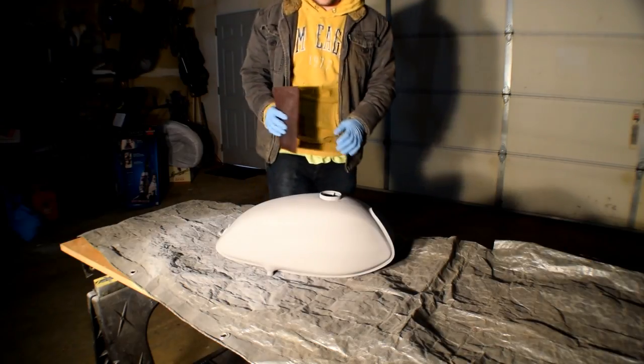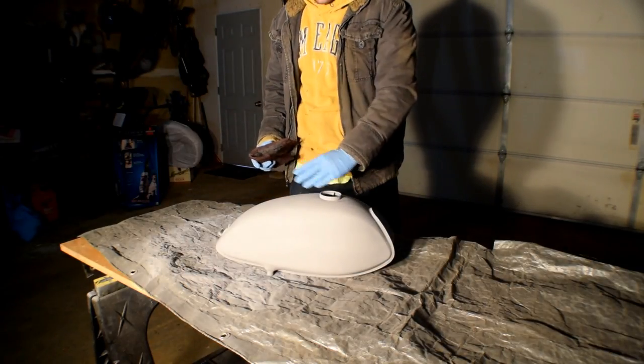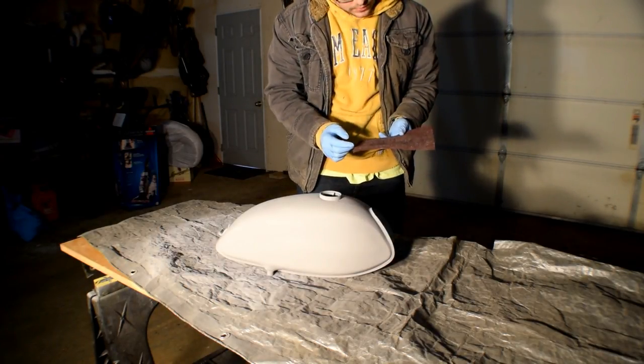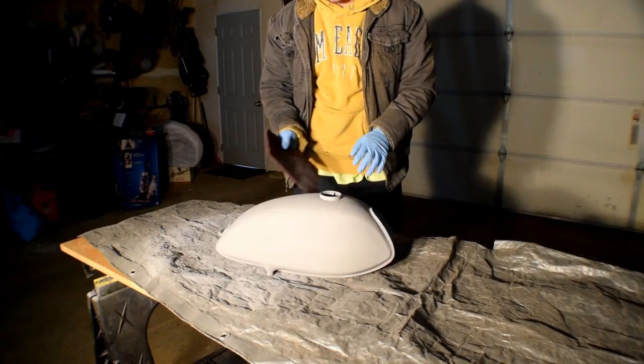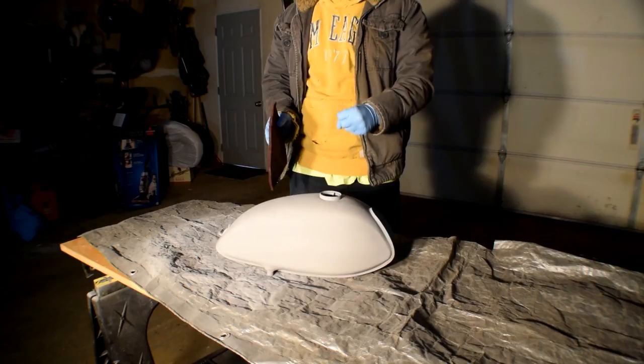First I am going to finish up a little bodywork outside and then just touch it up a little bit to get it ready. I did about three coats of this primer here. I'm just gonna rough it up with this red sand pad - the lettering is worn off, it's fairly high grit - so we're gonna rub it down, get some texture to it so the paint will grab hold.